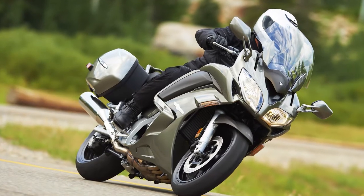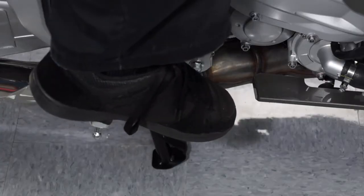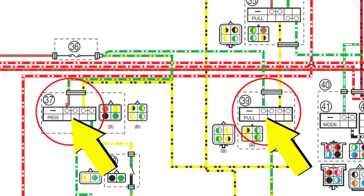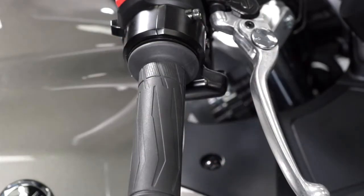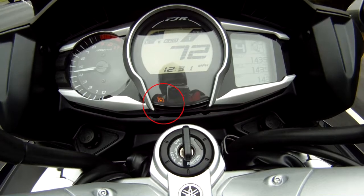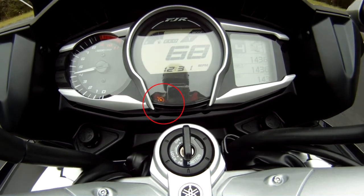A very important point to keep in mind on the new FJR is brake lever and brake pedal adjustment and pivot maintenance. There are two independent sets of contacts in each brake switch — one for the brake lights and a separate set for the cruise control system. If the brake lever or pedal do not fully return or are not properly adjusted, the rider may not be able to set the speed in the cruise control system. The cruise control power light would come on, but it would not hold speed.